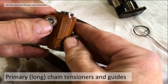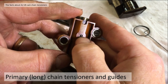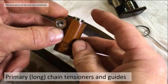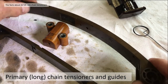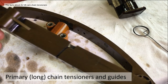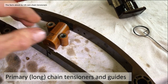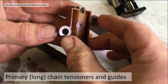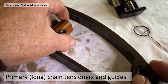The failure mode, if anything, is the tensioner again which can crack. This hydraulic piston is fed from hydraulic pressure from the engine oil. They can crack and lose pressure on startup, but even without pressure there isn't enough slack in the chain for it to jump a tooth and cause serious damage, I believe. This is why some people advise it's not necessary to change these. And looking at this 80,000-mile, 25-year-old car, you're probably right - but I did change them out and put new ones in.